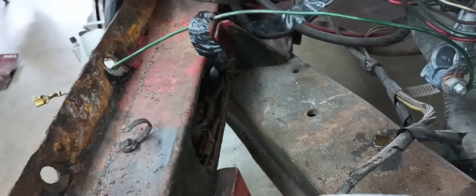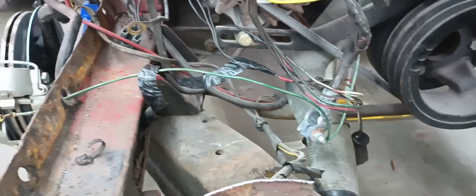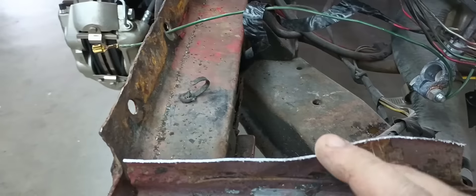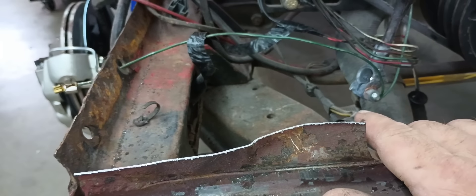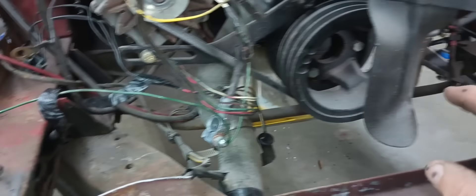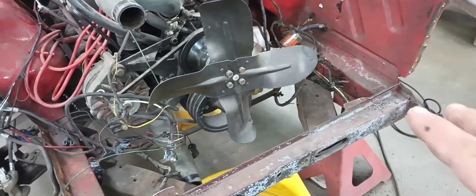The big thing is I've got to come in here and fix this mess. I don't want to have to put frame rails in this car in the front. So what I'm going to do is come in here and fix these nut inserts where they're all jacked up, and then I will simply patch this hole in the frame. I think that is the best option at this point since the car's front structure — the frame rails, subframe rails, all the cross members — don't seem to have ever been disturbed.